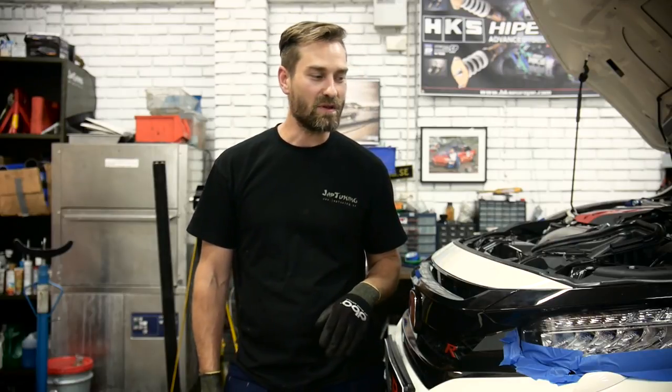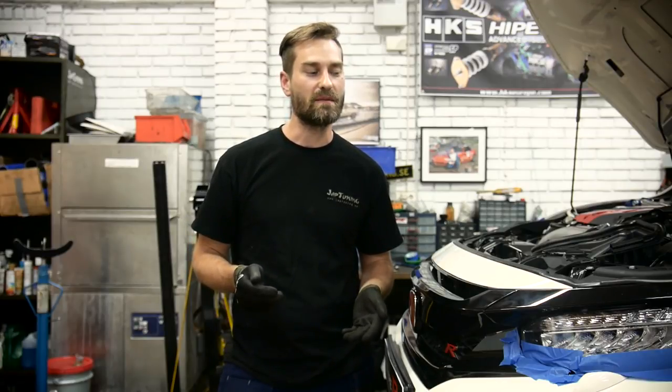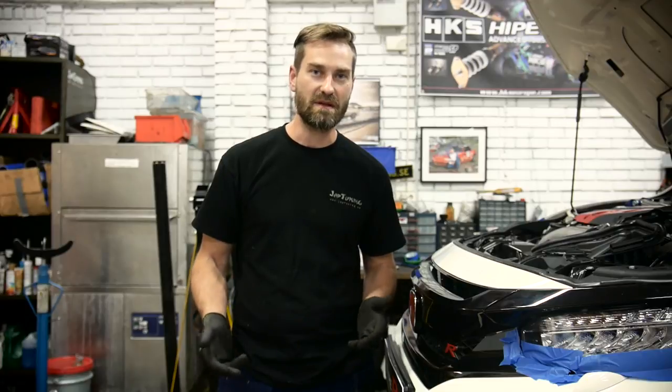You will see why we do this, because on a car like this that is turbocharged you need to cool the charged air. With the stock unit you will find its limits because of the size of it, especially when you go up to higher outputs like 400 horsepower — then you'll reach the limit of the stock intercooler. So today we will change that part to another one from PRL in the US, who have supplied us with a very nice unit that we will install here.